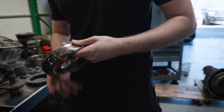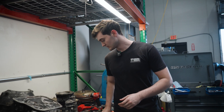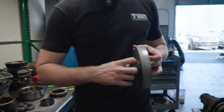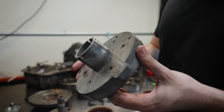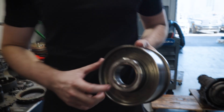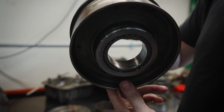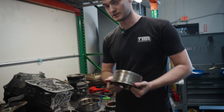You can also see there is a burnt used OE steel in there, which is not very good. That is not the quality that you want to see in a builder or in the products they produce. His center support was absolutely destroyed — you could probably even see the grooves in there. Same thing on his low reverse drum, same thing on the inside: grooved up. The low reverse drum is also rusty and not clean. Nothing inside of this trans was very clean at all.